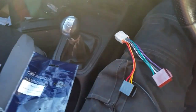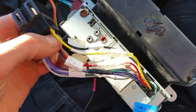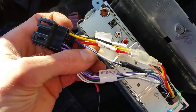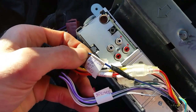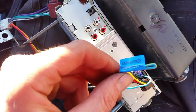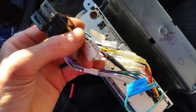These two connectors will fit into the back of my stereo unit. The speaker wire colors on the ISO cable match up perfectly with the colors on the car's loom. The blue wire is for an antenna amplifier — if you don't have one installed, it doesn't need to be connected. You've also got a spare cable here which is the steering wheel remote input, but I'm not entirely sure where that goes on this unit, and I never use it anyway.